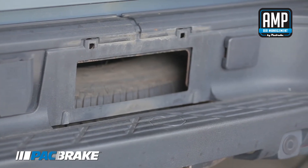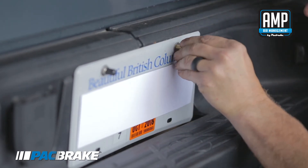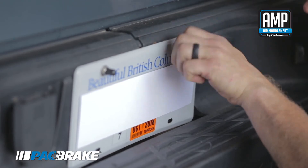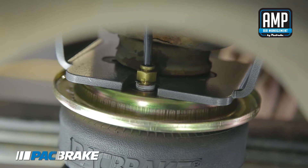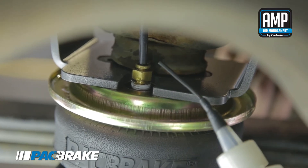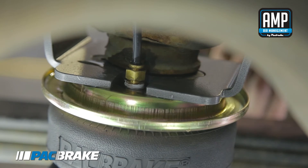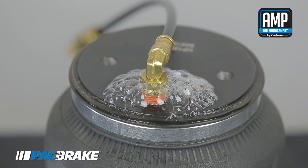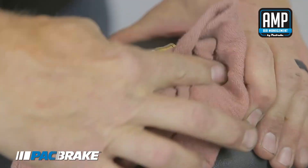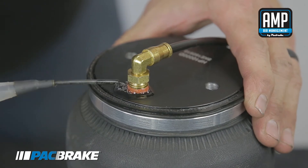Install the airline to the vehicle through the license plate mounting holes. Sandwich the Schrader valve using the included hex nut and flat washers, and route the air lines to the air springs. Perform a leak test to ensure the air fitting is fastened airtight — inflate the air spring and spray soapy water over the fitting and observe that no bubbling occurs. If bubbling occurs, tighten the air fitting until the bubbling stops, wipe the area dry, and spray soapy water again to confirm it is airtight.